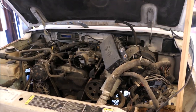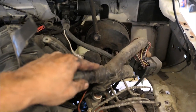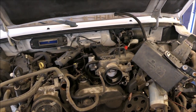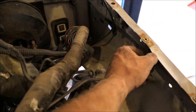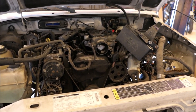I think it's time to try and give it a tug and see what happens - that's when you always find out which wire you didn't unhook or hose or whatever. Under the hood before I raise the cab up, I kept everything together as much as I could - the brake stuff, wiring harnesses and fuse box all kind of chunked together. Also, any bolts I took out holding brackets I screwed back in where they were so I'd know which bolts went where. I'm going to keep this cab around for other projects.